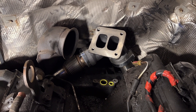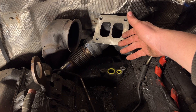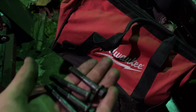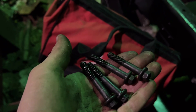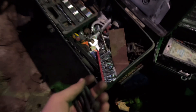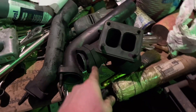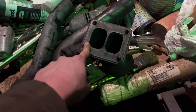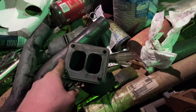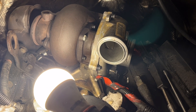I don't understand why they don't have studs like on the old collector — studs on the bottom and bolts on the top. The four bolts that hold the pedestal on are 10 millimeter. If you're watching this before you take the turbo off, I suggest you pick up a set of these swivel sockets because with the turbo in there and so little space, you pretty much have to have them to get those bottom two bolts off.